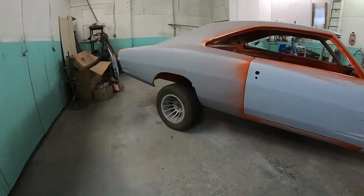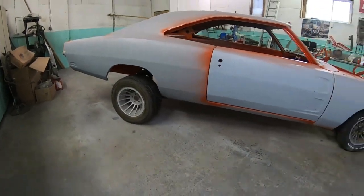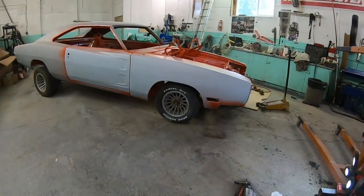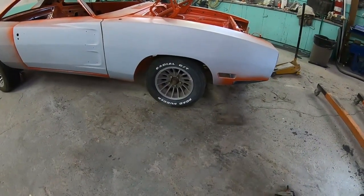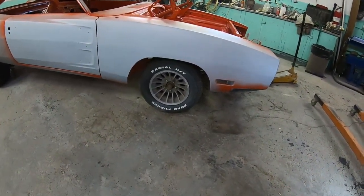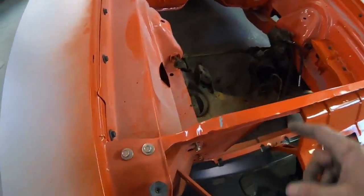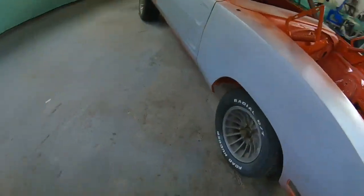It's 1970. Got the air shocks aired all the way up, going out for some street racing. So, front K-member installed just loosely. I think I only put in 3 bolts and they're just sort of snug, enough to roll the car around, and upper control arm bolts are just going to push through halfway to keep them in place.